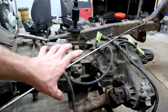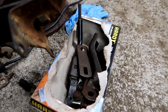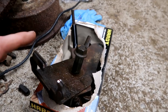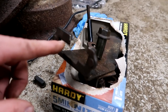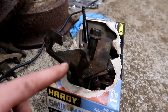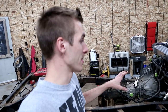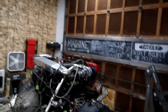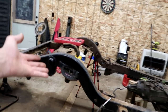I took off all the rusty, crusty mess that was on the transfer case — tore that all apart, which took a very long time. It's sitting right here; I'm trying to keep everything grouped together. Everything in there will be sandblasted, and some components will not be. I actually had to cut one portion out in order to get one of the bolts out, but once it's sandblasted we'll weld that together and it'll be brand new. Now I want to assess the situation for either the engine and transmission removal or just the front end, because I want to get this frame to the sandblaster so we can start building our brand-new foundation.